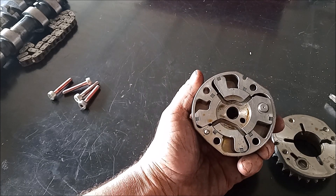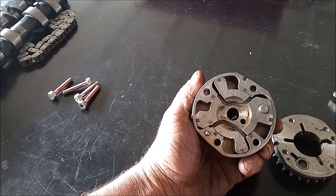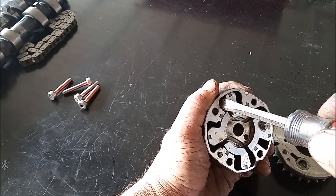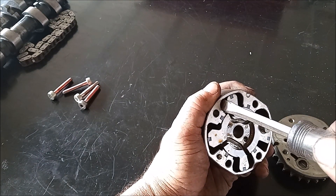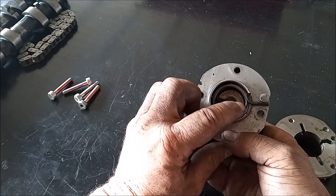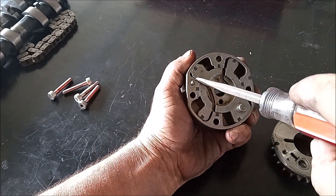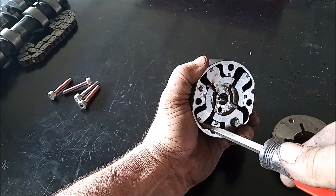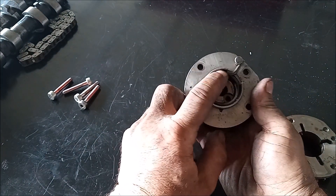You can see that this is in the position of maximum advance, and the oil pressure builds up on one side and moves the gear to retard the opening and closing of the exhaust valves. This gear is built such that the spring on the outside is always returning it to its locked position — when I pry it loose it just comes right back because of this spring mechanism right here.